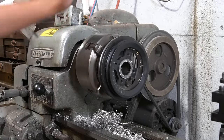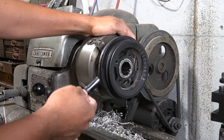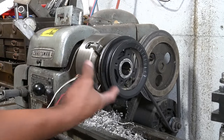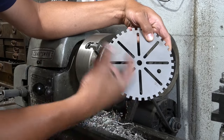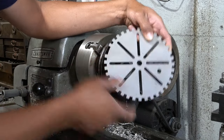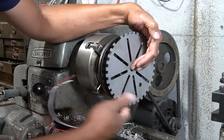I've got the crank pulley for the 22R tucked up in the lathe — let me explain what I'm doing here. To get really accurate timing control, the computer needs a signal that tells it not only the RPM but also the position of the crank at any given time — where top dead center is on all four cylinders. The pickup in the distributor doesn't tell it that; it would only tell it that a cylinder is on top dead center, not which one. The best way to do that is to add a toothed ring — a skip tooth ring. This is called a 36-1: there's a tooth every 10 degrees, so 360 degrees divided by 36 is 10, and that includes the one missing tooth. By mounting this to the pulley with a hall effect magnetic sensor, the computer can count to the missing tooth and know exactly where the crank is based on how you program it.